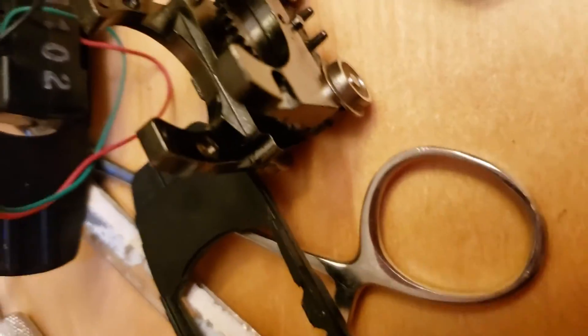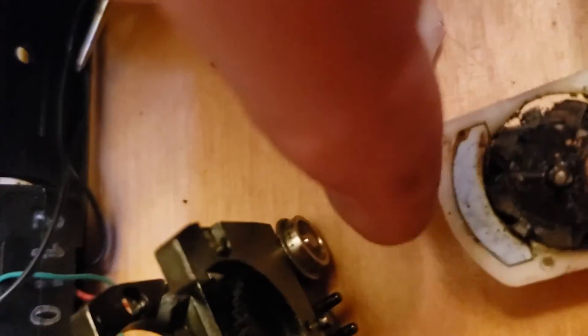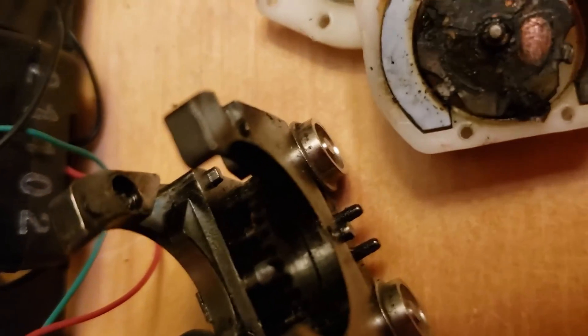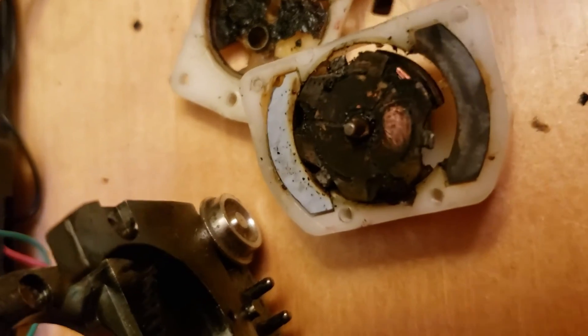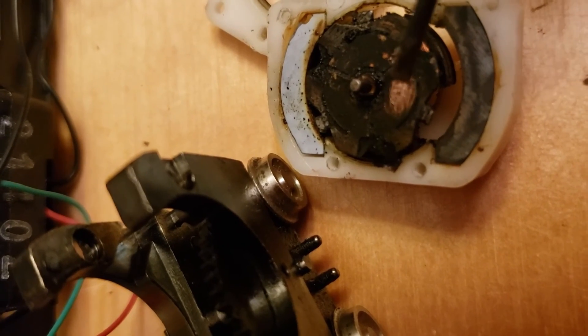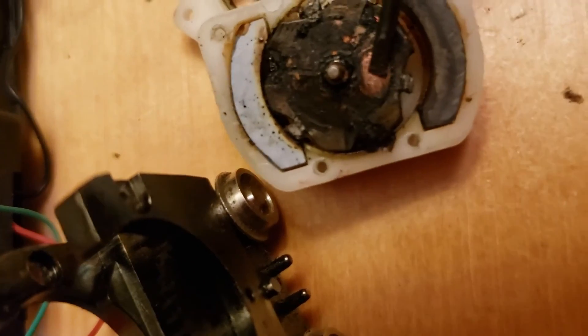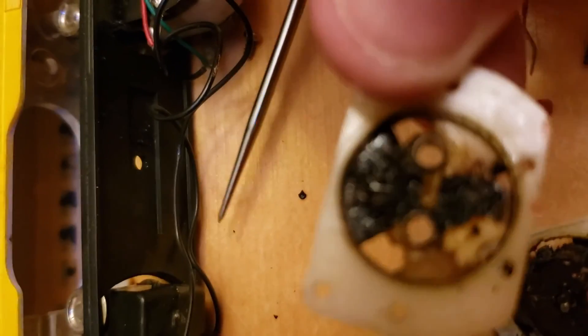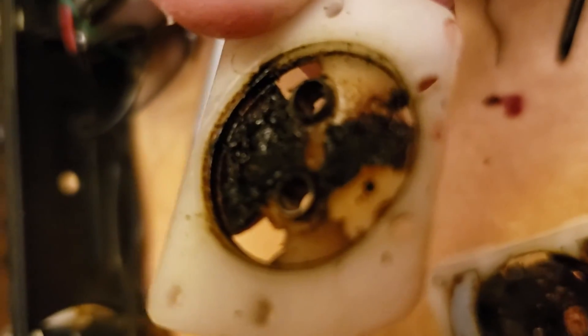This one says 'works' - that's the one that makes noise. I thought I could use some gears from one of the other ones, but I couldn't get this motor working. When I looked inside, I scratched away all the corrosion. It looked like it was on fire, honestly - it seemed charred on the inside. But that's the color it should look: nice and shiny copper color. The brushes on the motor will make good contact, but the inside looks really nasty.